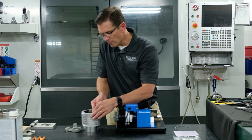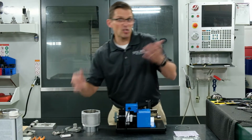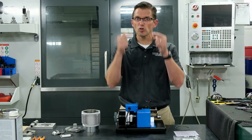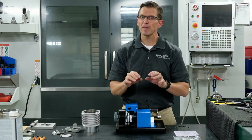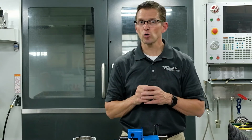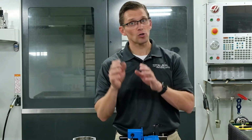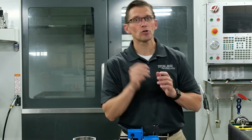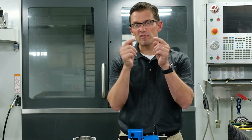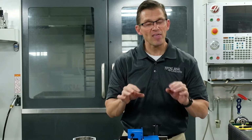And it goes right in perfectly. So, for example, if we wanted to have a little bit more ring end gap, because let's say it's a turbo engine and we're going to race it, we want a little extra ring end gap so the ring ends don't butt, because that's a huge problem. You can get by with extra ring gap. In fact, CP, which is part of the Pankel group that does OEM work for Porsche, recommends end gap 4 to 8 thousandths looser than many other manufacturers recommend, because with a looser end gap, you prevent the risk of butting the rings, which can cause piston seizure, welding, and lots of bad things that you don't want to happen.